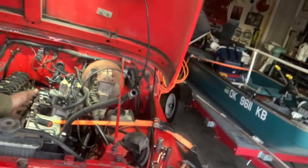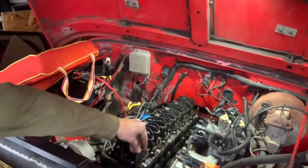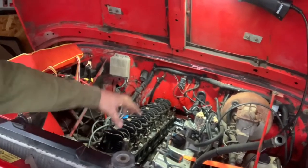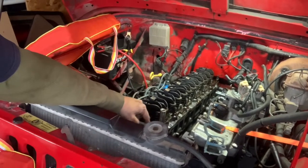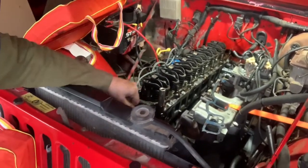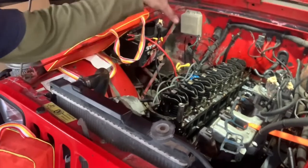So it's the following day. I said some bad words last night trying to get these last two bolts out. I just finally got them out. So the intake and exhaust manifold are off. I just put a strap on here to kind of bring it back so I don't have to disconnect anything else. Now we're going to go ahead and start doing our head bolts. Just verified we've got a five-eighths here. So we're going to start taking all these head bolts off.